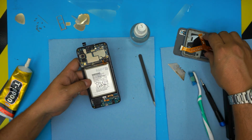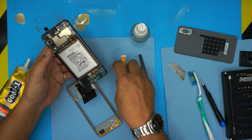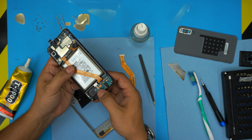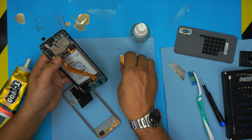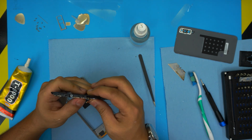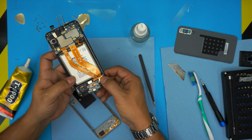now you're gonna grab the bottom case. And before we put the bottom case in, I forgot we gotta put this cable. So put the main side down here where it says main. Just align it and pinch it down, and press it down on this side. The other cable, you just have to align it right on top. There we go. It just snaps in place if you align it nicely. Align the bottom.